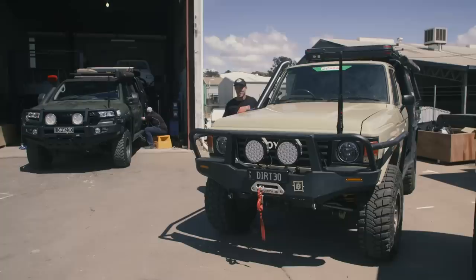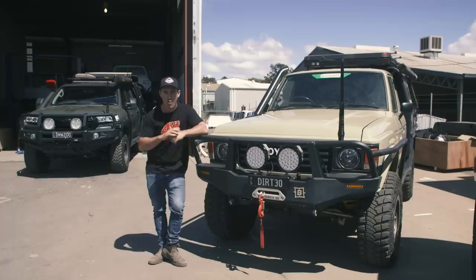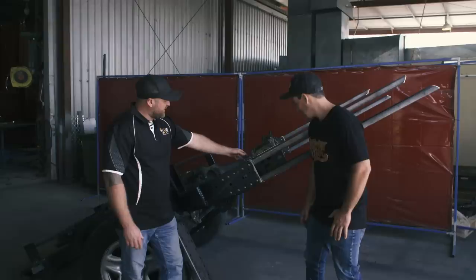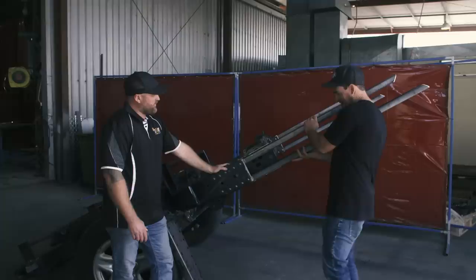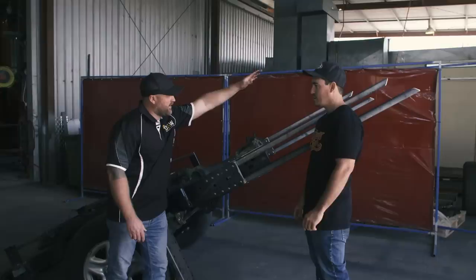It's been exactly a week to the day and I'm back down at DMW. Ruben said to get in quick because a lot of work has happened on the 200. He sent me progress shots early in the week but then went quiet. Here we've got the back half of the 200 series already chopped and wheeled outside. These are the big braces that go right up the centre of the chassis — they're in thicker than the standard chassis, going roughly 300mm down on the rear side and roughly 400mm up the front. That shares the stress load and sends it all through the chassis.